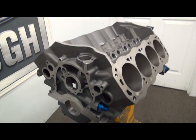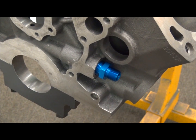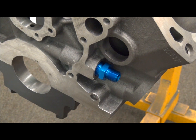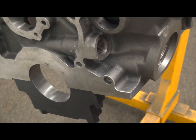Let's start at the front here. First thing you'll probably notice is this fitting that is in the oil pressure area. The difference with this block versus the SHP or the Sportsman is that's a dash-10 fitting there — it's not a tapered pipe thread. So you will have to figure out what you're going to do there to reduce it for your oil pressure.